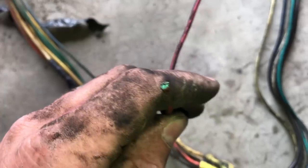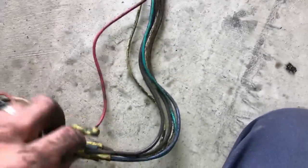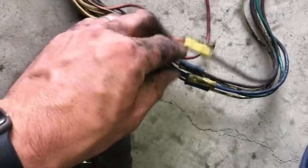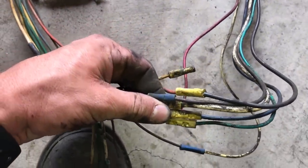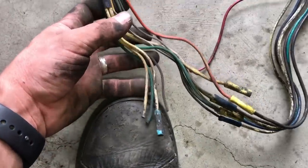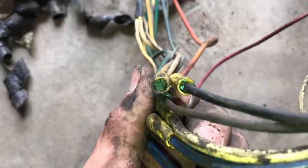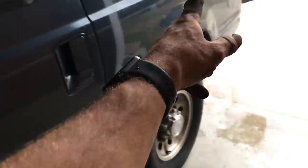I followed that red wire back and there's the cause of our problem right there. If you look closely, you can see all that green corrosion that caused the wire to break over time, and the inside is full of corrosion as well. The whole harness is like this. Somebody did some work to this at some point, which caused the problem — that is definitely not factory from Ford. There's a bunch of other wires that have been cut, some really goofy stuff going on with this harness. All those other wires have started to corrode too, so it's only a matter of time.